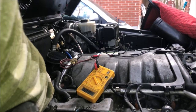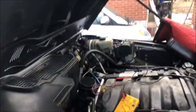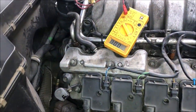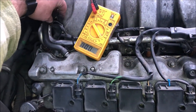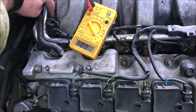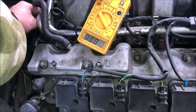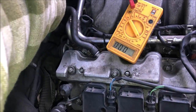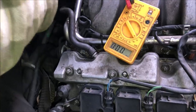Okay, hold on a second. I wasn't thinking. Just because it's calling for vacuum doesn't mean there's enough vacuum in the engine. At idle, there might not be enough. So let's do an on-off throttle and watch that valve. It's going to be hard to do. Okay, plugged in. No, I thought cutting off airflow might do it.